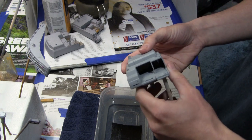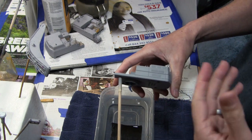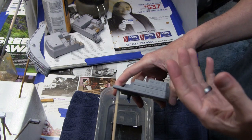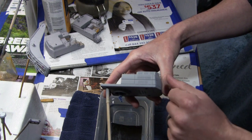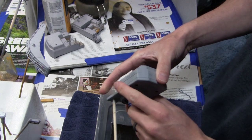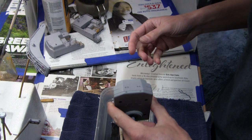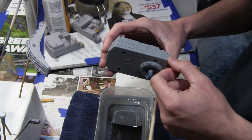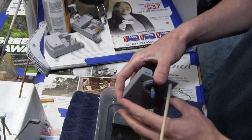The paints that I'm using don't require primer. Priming is a good way to ensure a little bit of a better adhesion when you're using paints that don't require primer. But in this process of wet sanding this, if I wear through to the metal on some spots, I'm not going to be that concerned about it because I'll still be able to paint over it fine. Another nice thing about primer that I mentioned earlier is that you're able to see little mistakes that you've made, and you can go back and fix them if you wish.